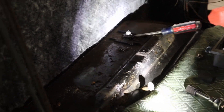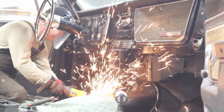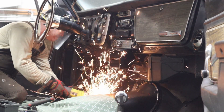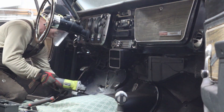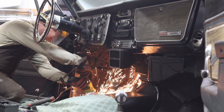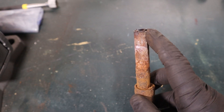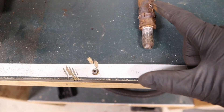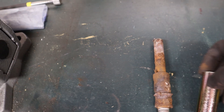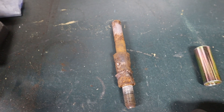So we're just going to cut everything out — the rusted bolts, the castle nuts — and eliminate any future problems. You can see I'm cutting off the bolt heads in order to push them back down through the floor. These metal sleeves that come with the new bushings were completely rusted to the old hardware, so there was no other choice.